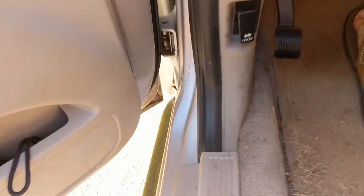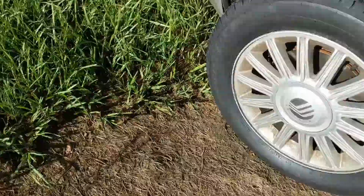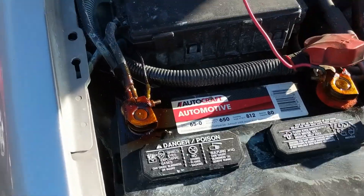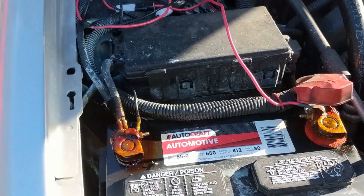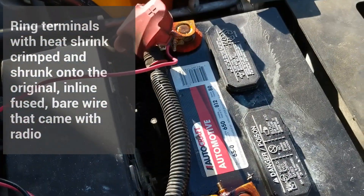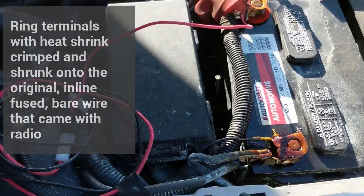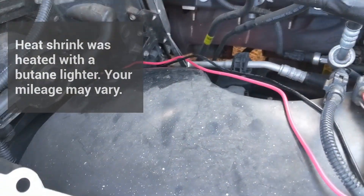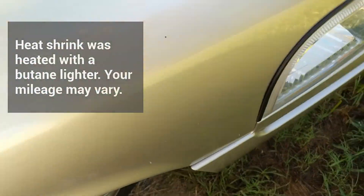Just to show you what that looks like under the hood — over here I've got a couple of ring terminal connectors that run to the battery. These cables are actually the cables that came with the 7250, and it's got inline fuses that run down to that grommet just back there, and then it comes in on the passenger side.